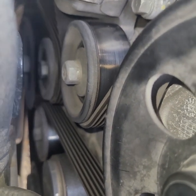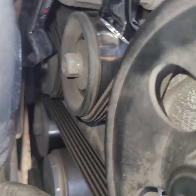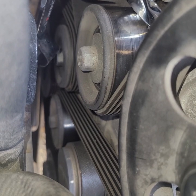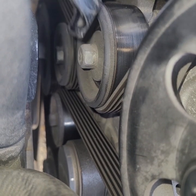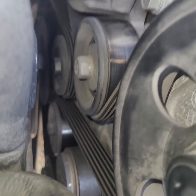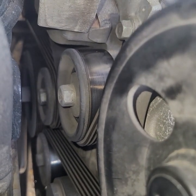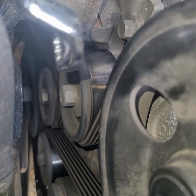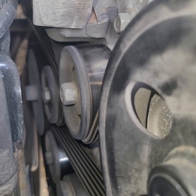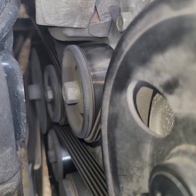So there you see this one, and the one right past it — that is the tensioner pulley. That's a 15 millimeter or 17 millimeter bolt. We have to make sure we don't lose track of how this serpentine belt goes around, so I'm definitely going to get a diagram of it so we can use it later.